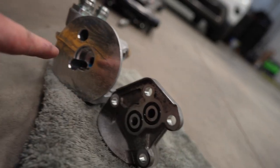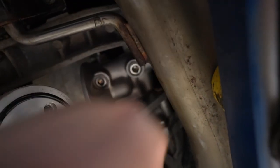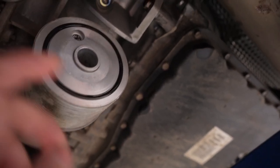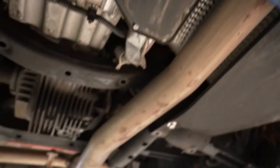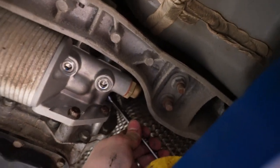I have to admit I was quite excited to put it back in and was pretty happy — and of course I forgot the o-rings. I managed to get all three bolts in and the fourth one at the very top is in but I haven't been able to tighten it yet. I got the o-ring in the heat exchanger and I need to create some clearance — so I took the exhaust off. Then I took off the rear under tray, got the ratchet in, and it's all torqued in. Amazing — just a little bit of clearance made all the difference.